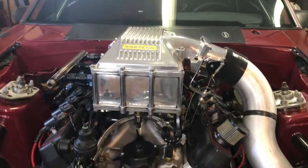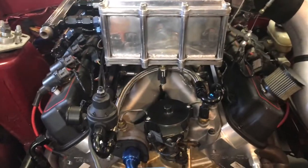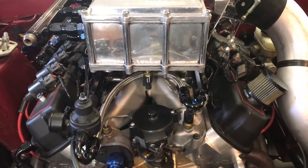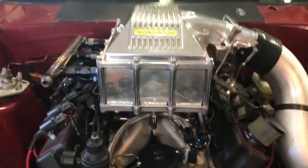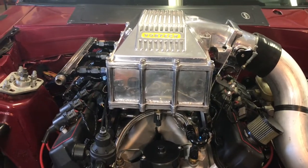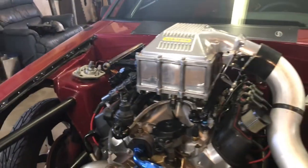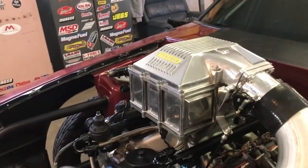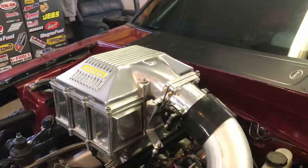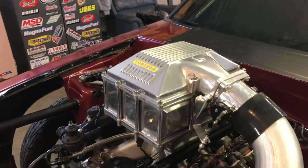They're just so old now that they're just not out there anymore. This one's even really rare because it has the 4150 base plate — just a standard 4150 square base plate attached to my Trick Flow R 4150 intake, which has never been done before. You usually see these with a Trick Flow inline intake or Holley Systemax or even a GT40 lower. The 4150 is a little bit harder to get.